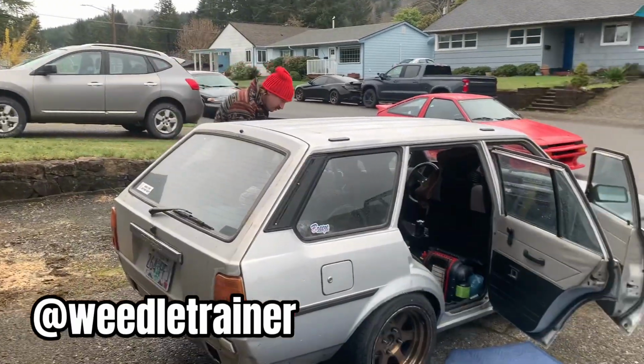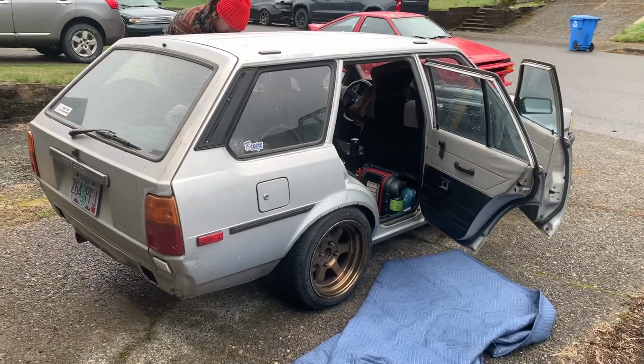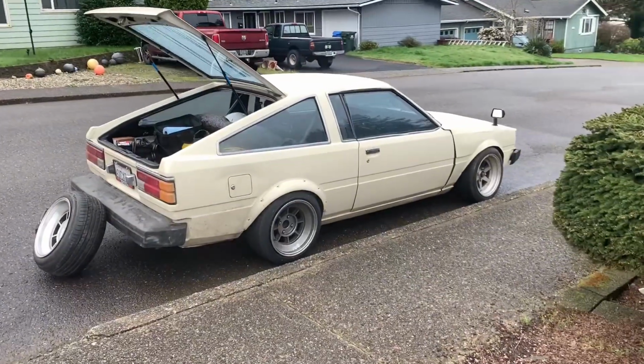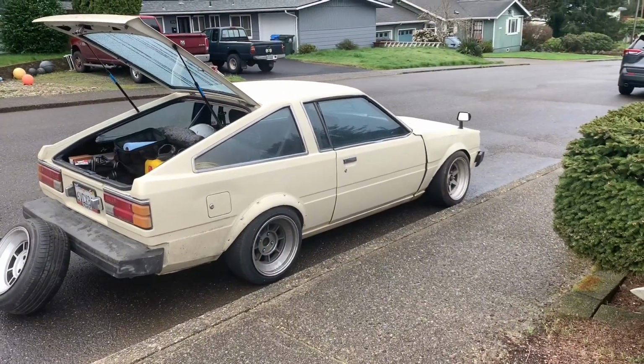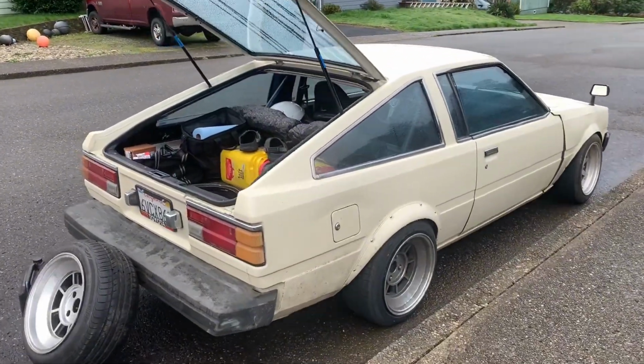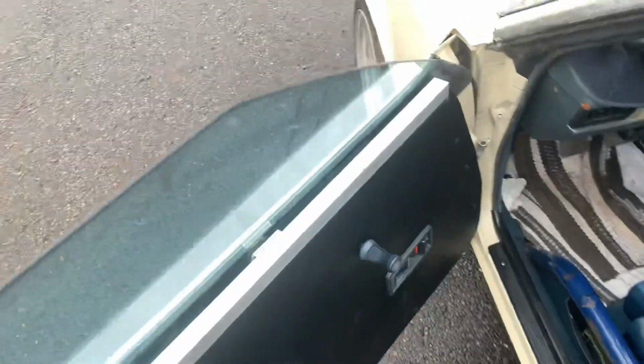This guy is going to adjust his thrust angle or his pinion angle because his car is loud. I'm gonna be messing around with the cold start and modifying the map, because my car never goes out of cold start. That's why I'm getting 20 miles a gallon, probably because my thermostat's stuck open, so it's running like 160 to 170 on the highway.